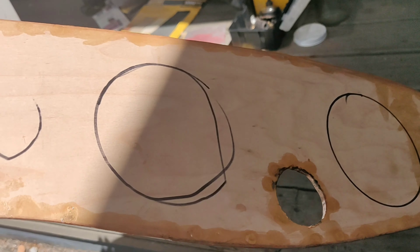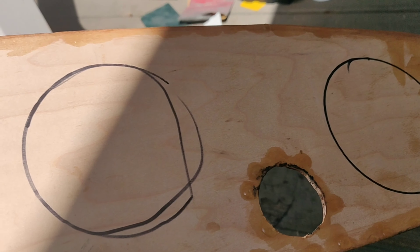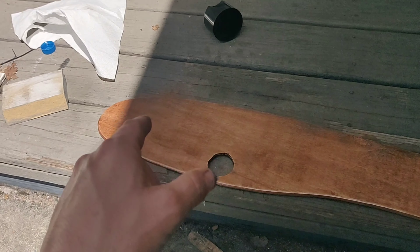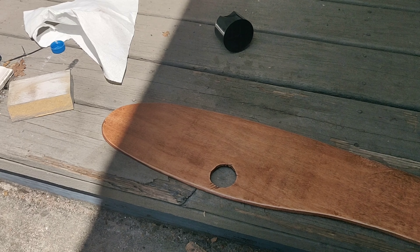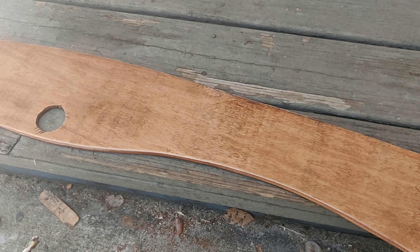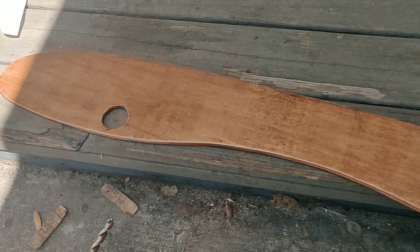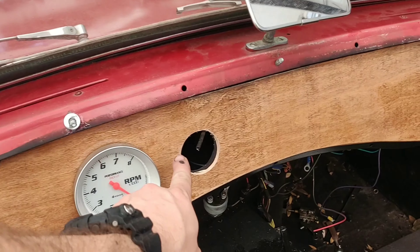You could also use a hole drill but it would need to be pretty large — I think it's three and three-eighths inches for the gauge we're using. These holes are a little bigger than the gauges, so I'm going to mock up the gauges, draw another circle, and cut to that so we don't cut too big a hole. Originally I had that issue and had to put a ring inside so the gauge wouldn't fall through. After that we'll start mocking up the toggle switches, which go in different spots, and the final thing is our handle to help secure the dash on the side with no gauges.